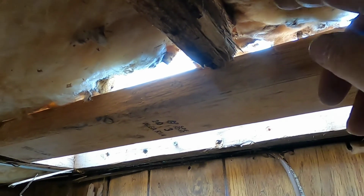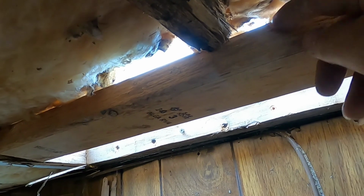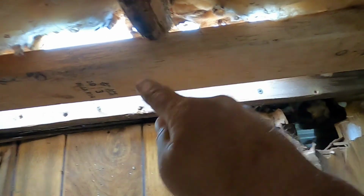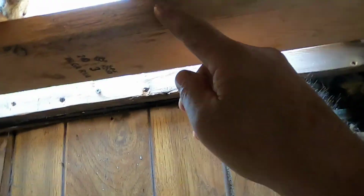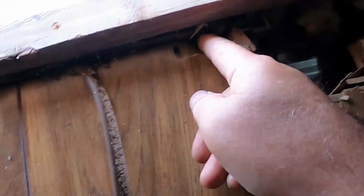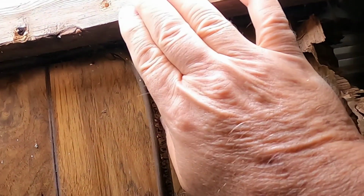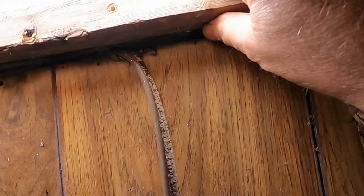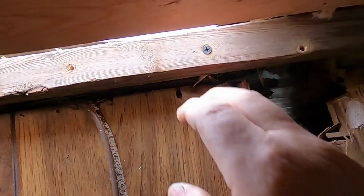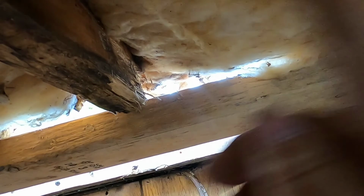What I plan on doing is to put that piece of sheet metal in, drop this down to where it's got to go, and I have these angle brackets that I'm going to screw into here and to here. I put this in, so when I screw the sheet metal from the top, it has something to bite into. And this piece of wood was rotted over here. This piece of wood I added on. It was an afterthought. It was a little difficult getting those screws in there. I have 2.5 inch screws going through it, so the end piece of the sheet metal also has some solid wood to screw into. So this is going to be supporting this area here, in addition to this cross member.